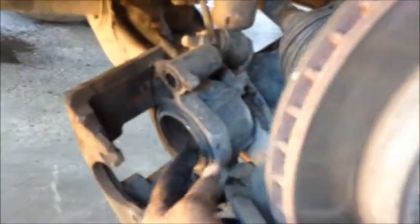So all right, we did that. Now we're going to go ahead and slide the brakes in there. If you notice the difference in these, the one that clips in the center like this and folds back, this will always be the one that goes up against the slave cylinder, because that has to push inside the hole.